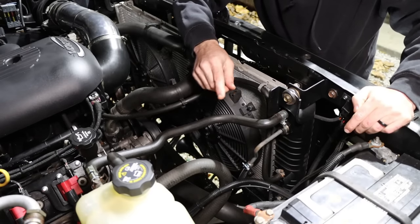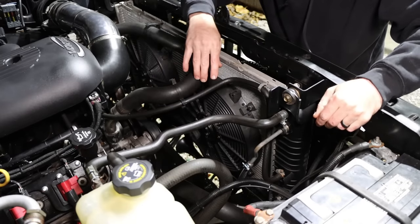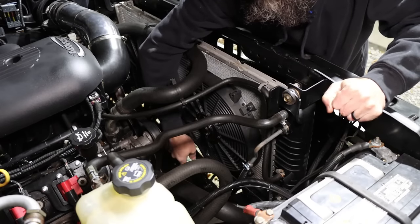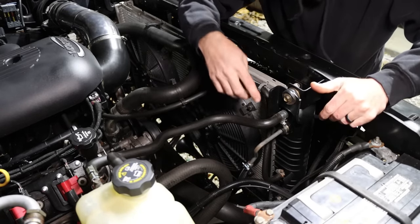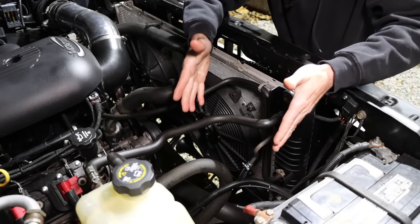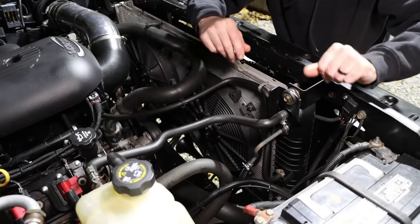And the reason I wasn't using it is because this radiator came out of that parts truck and it had a burnt transmission, and I did not want to risk flushing a bunch of trash out of this cooler into the transmission. So I flushed it out as good as I possibly could, and I'm hoping that it's good enough. So now the way that my system is set up, and which should be plenty sufficient, hot fluid comes from the transmission through this line, runs into the bottom of the side tank of the radiator here, which houses a small fluid-to-fluid heat exchanger, and it dumps some of that heat from the transmission into the same coolant that is used to cool the engine. It comes out this top line, and then it runs to the stacked plate air-to-fluid cooler that I have on the front of the radiator here. It goes out of that cooler after dropping temperature even more, and then goes back to the transmission. After it's all done in that cooling loop, that should be enough to keep this thing cool.